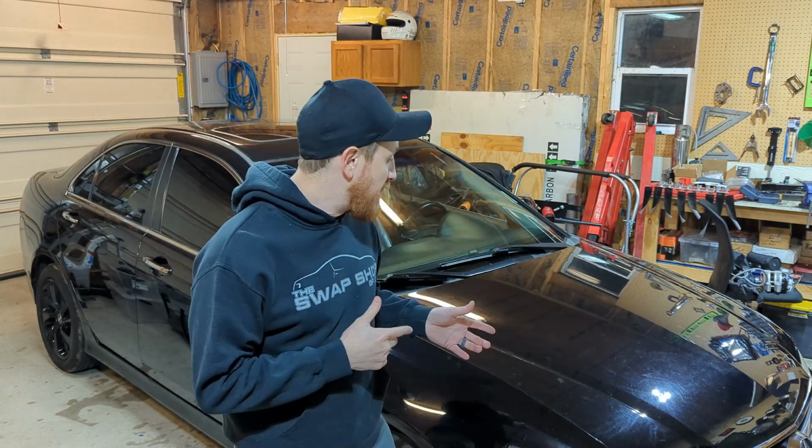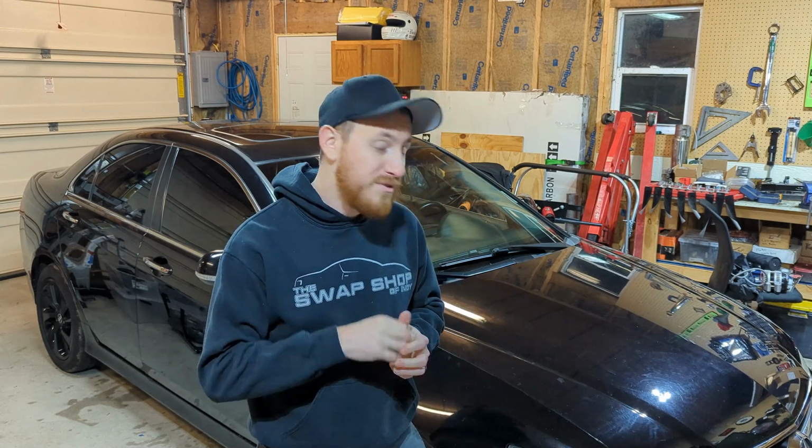So upon further inspection, I got out my multimeter, checked the battery, checked it when it was running, and I was getting pretty much no output from the alternator. I also checked a plug on the alternator, which I'll show you here shortly in the video, to see if the alternator was even getting signal out to it. And unfortunately, it was. So I guess fortunately that was good, but it pretty much told me that the alternator was bad.